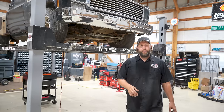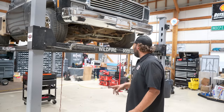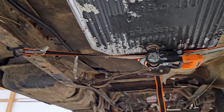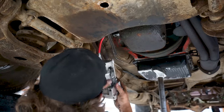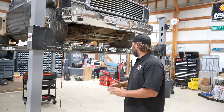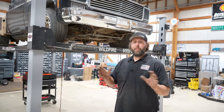Well, I think a guy's got the underneath of said truck pretty well dialed in. Got the transmission crossmember out. I got my ratchet strap across there, just wheezing, barely hanging in. It'll do the trick though. Dropped the starter out of the way, took the cooling lines off because I don't know what I'm gonna do there yet. Take them with the engine and transmission or just pull them out separate. Also went ahead and drained the oil there. Got the shift linkage disconnected, the speedometer cable, pretty much everything.